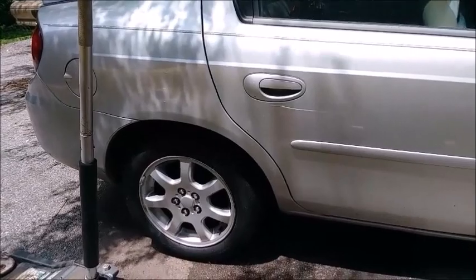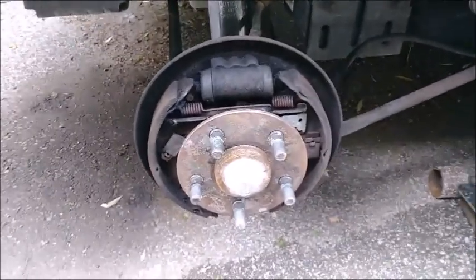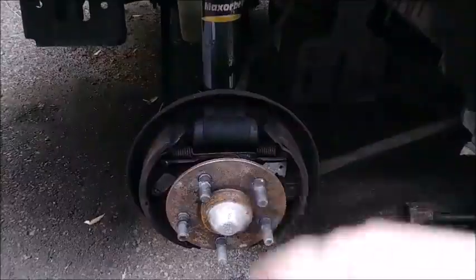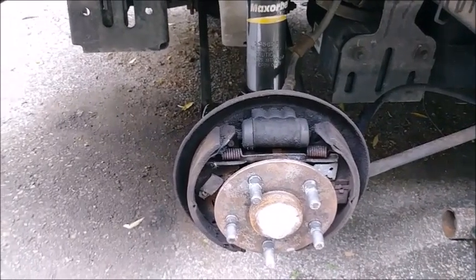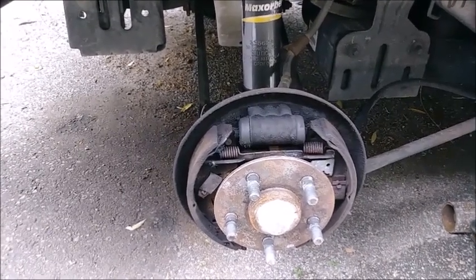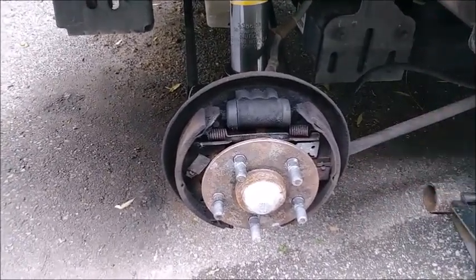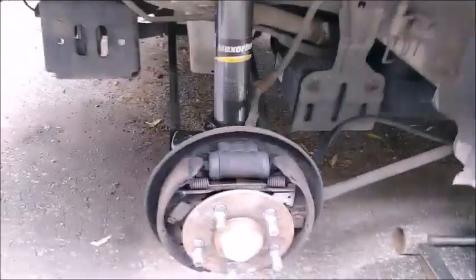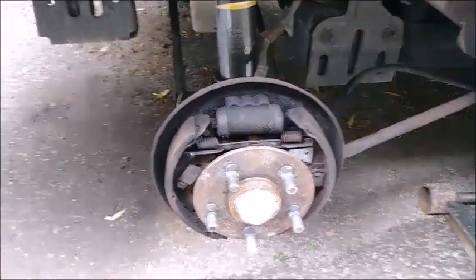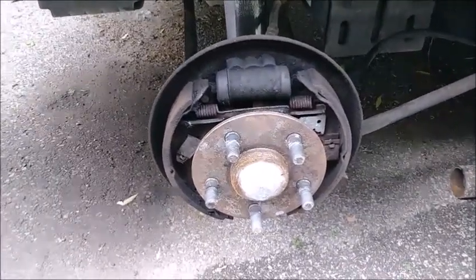Front wheels are chalked because we're gonna be jacking this thing up pretty high on both sides. We're also gonna have to bleed the brakes once we bust the wheel cylinder off, which means we have to do this side first — you start in order of operation from furthest to closest to the master cylinder. This is the furthest, so we bleed this first. If I really feel like it, I'll do the fronts too, just so the system is completely bled. I hate this car and I'll be excited the day somebody finally totals it.